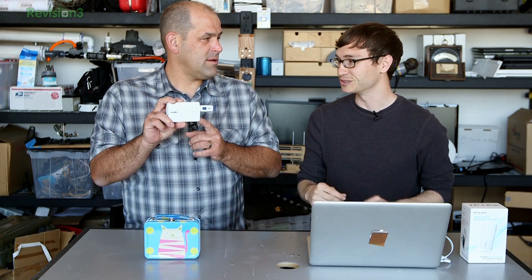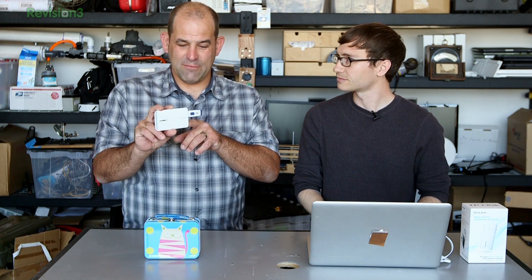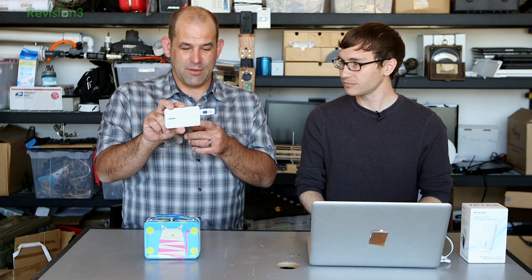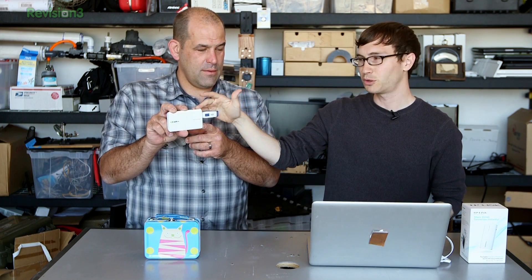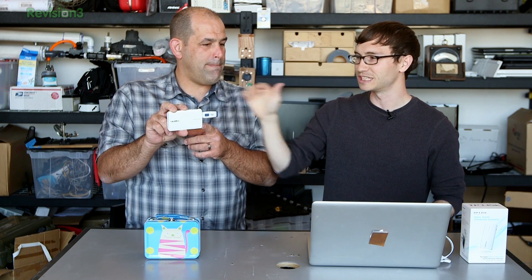So we have this running on a Raspberry Pi and then I also have it running on a TP-Link router. This thing is so cool. It's made to plug in one of your USB 4G or 3G modems, it has a battery built in, and then it makes it into a Wi-Fi access point. At this point we're looking at maybe four to five hours of sustained battery life off of this. It's $35 for this built-in solution — the last one of these I bought was like $125. Let's go in and show how to set up one of these because the performance is a little bit better and it's way easier, so we'll show this first.